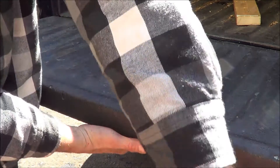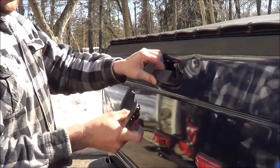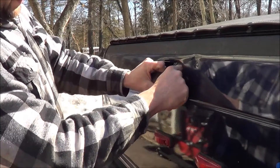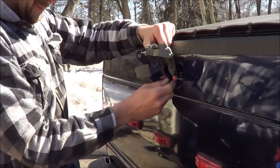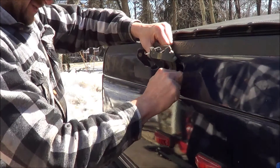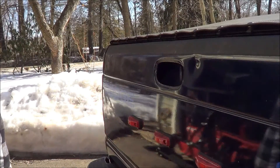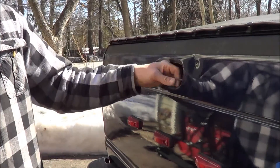Once the screws are out, you can just lift this trim out. Then the handle should be pulled out just a little bit to clear the sheet metal, and you can lift the handle up and out. There are two clips here — you flip them upward. They may be a little old and cranky, but they'll come. One rod out, then the other rod, and there's your handle. The rods don't fall very far — there's a reinforcement piece in the tailgate, so the rods are still there.